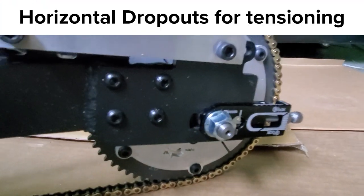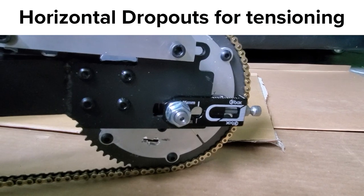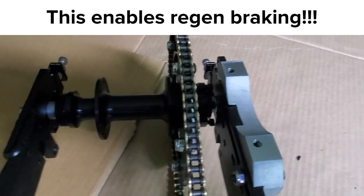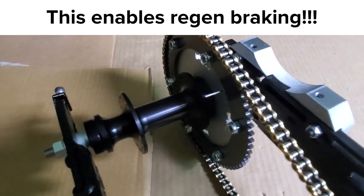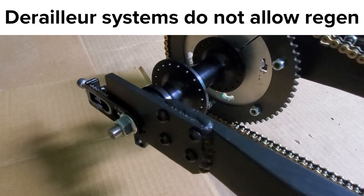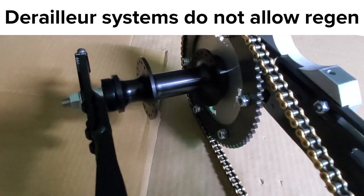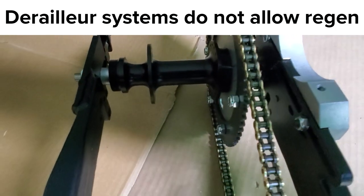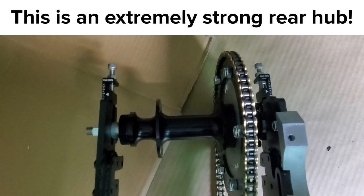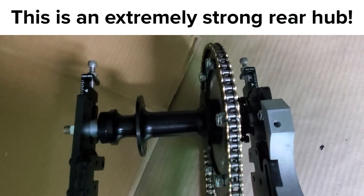If we go to the back of the motor you can see that the aluminum block here is for mounting and positioning the rear disc brake caliper. The rear dropouts were extended and converted to horizontal chain tensioning, and these are the mechanisms that do that job. Having the chain tensioned in this manner is very important as it will allow for the use of regenerative braking with the mid drive motor — if the chain had been tensioned using a derailleur or a spring based tensioner, running the chain backwards under regen braking conditions is not possible. The rear hub is a 32 hole custom made billet, and it might be the very last of these as they turned out to be not very cost effective.